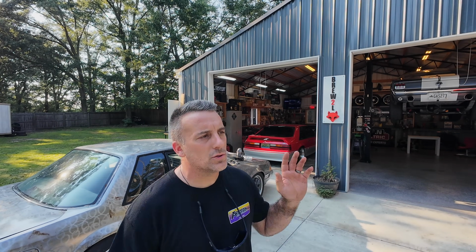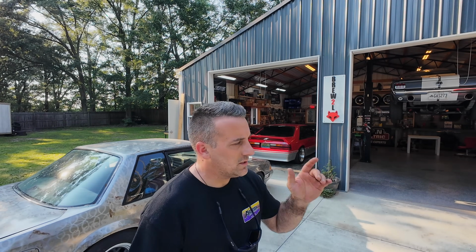Change gears out in the car, because I don't know if it's a pinion issue, I don't know if it's a transmission issue, but I think the right move here is to go ahead and put a set of 410s in the car, which is what I wanted to do anyway. This cam does not like 373s. We're going to put 410s in it and see if that doesn't fix the problem. It's something I wanted to do anyway, so it really makes sense.